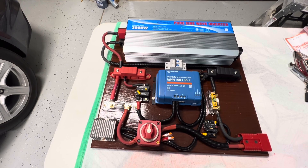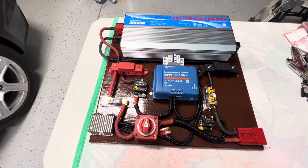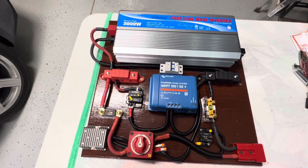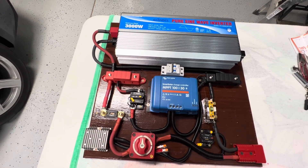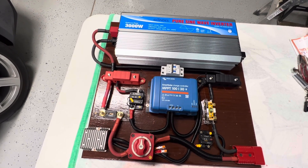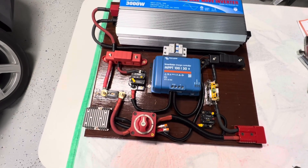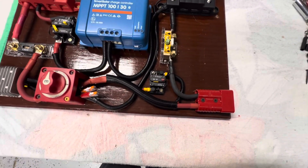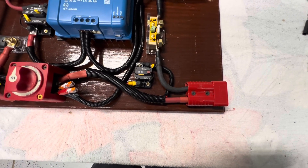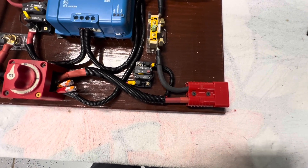Here's a surprise for you. Remember the board that was just sitting up against the garage door? Look at it now. How does it look? This is a nice system — 3,000-watt, 24-volt inverter. It's almost complete. Only got two things to do to it: hook the solar wire to the switch. And I did something different on this — I put a plug on the end so all you got to do is connect your batteries to another plug just like that and make the connection, and then you got voltage going into it.